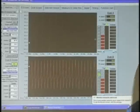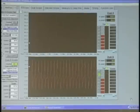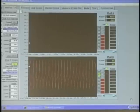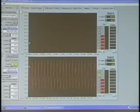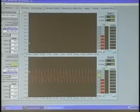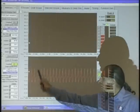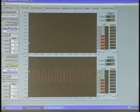If you're using a scope and you want the picture bigger, meaning the amplitude, you're going to need to lower the setting. Sometimes it's going to look small like this. If I want it big like this, I have to lower the voltage. You may want to write that down. So watch. If I make this voltage higher, what happened to the reading? It made it small. Still got the same reading, peak to peak. And this is important to look at.